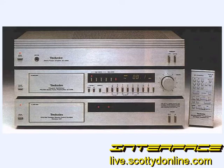A stereo receiver is actually three components built into one. This very high-end system we're looking at here has a power amplifier, a pre-amplifier, and a tuner. The tuner is self-explanatory — it's used to tune in radio stations on the AM and FM band. The pre-amplifier is a box that allows you to hook all of your inputs up and controls the volume of the system.